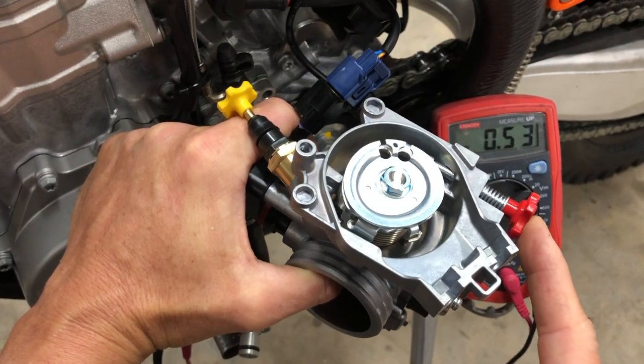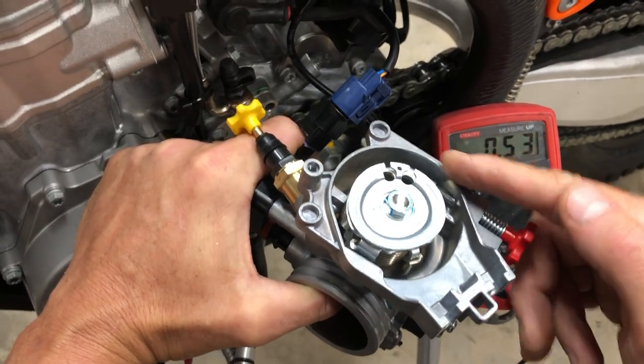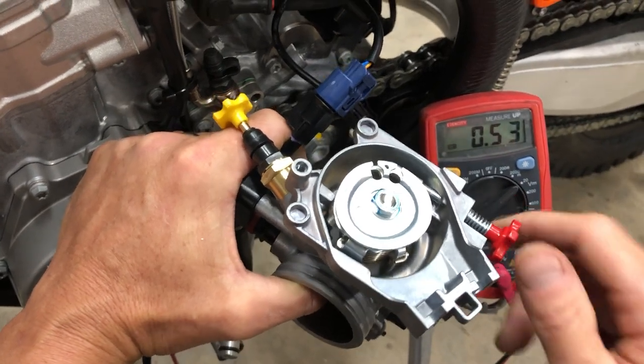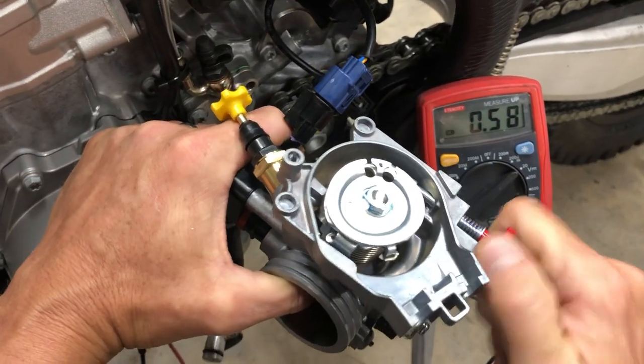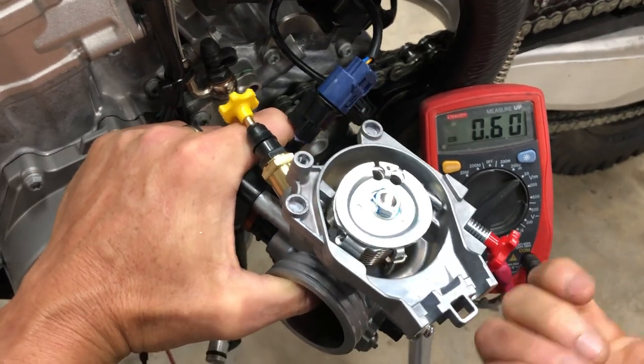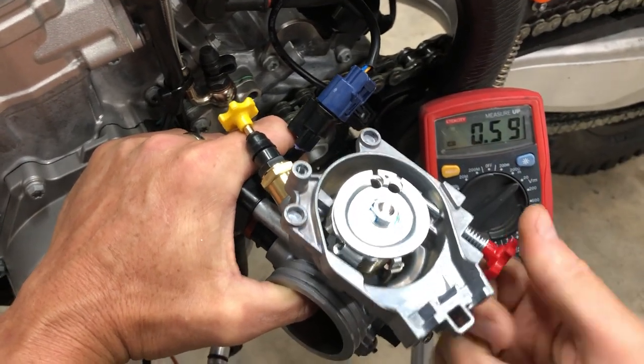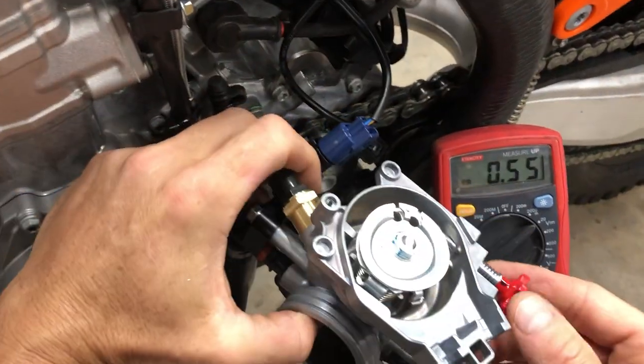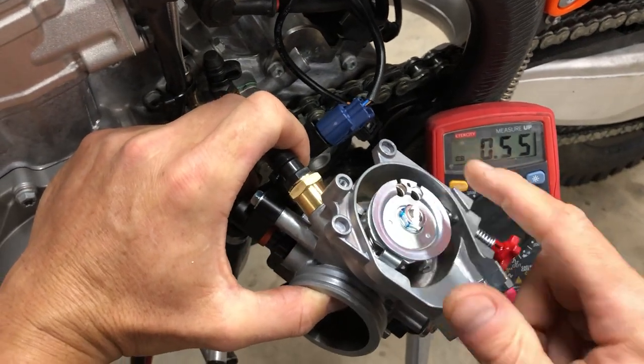The true base number for a true calibration is to pull that away, like we just showed you, and set the value at 40. And then whatever this ends up being, so that your bike will run at 1800, is what it is. It could be 60, it could be 53, it could be anywhere really, but it really needs to be set to fully closed.